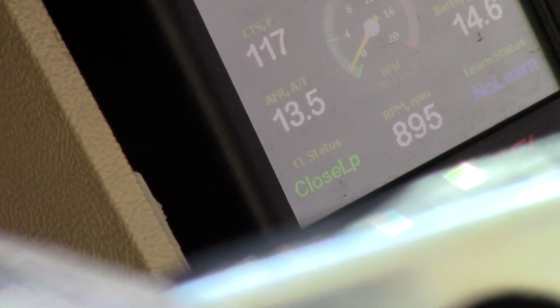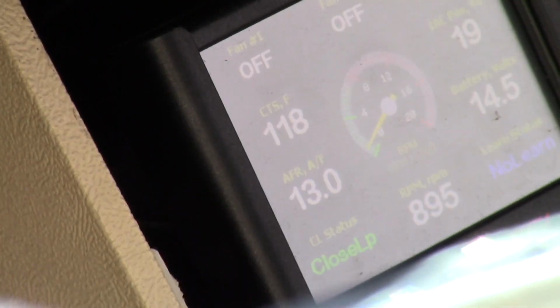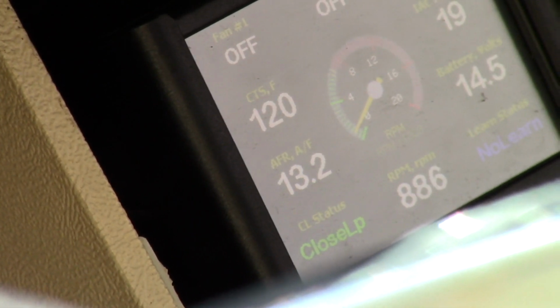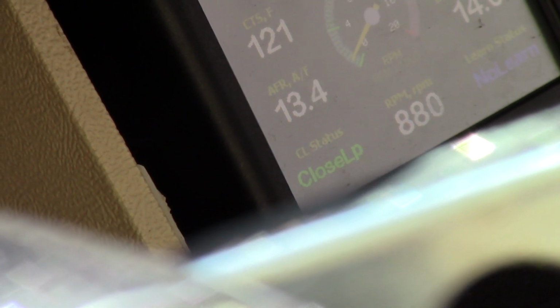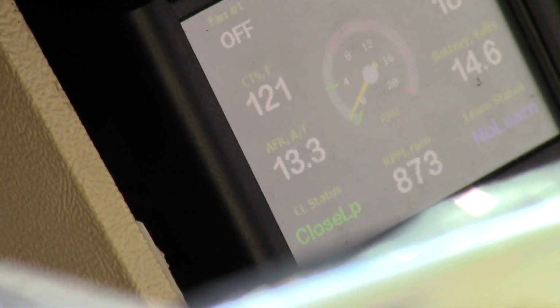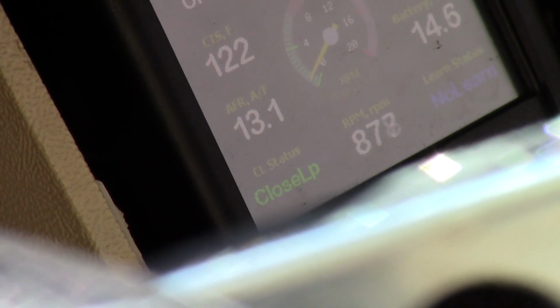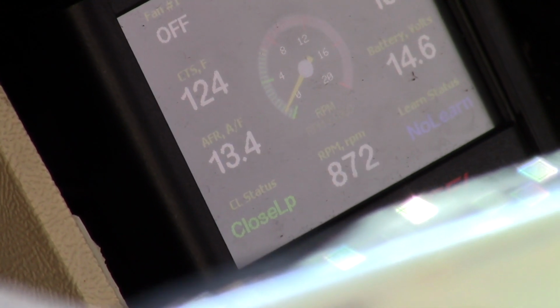And if it does, you got to shut it off, let it cool down. It'll suck some of the fluid in and the air will come out if that happens. It looks to me like it's a steady rate up right now, maybe a little faster than normal, so that tells me there's probably a little air in there, but it's all right. So we'll wait till the thermostat opens up, and once the thermostat opens up, it's going to have a whole bunch of air that belches out, and you're going to want to keep feeding it with fluids until it won't take anymore, and you stop seeing air bubbles coming out.